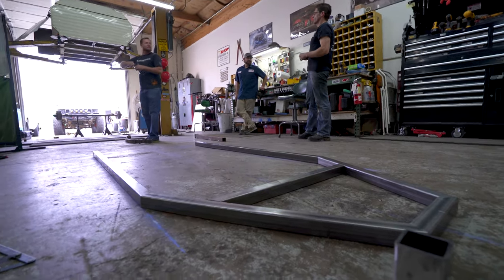I'll have a receiver in the back for my bikes. You want the coupler-to-axle distance to be the same as the wheelbase of the tow vehicle, and that hopefully will make it a lot easier to back up. With this short trailer it was just a pain to back up, and with the Ford it was almost impossible — just going back and forth. So now we'll have a much longer trailer tongue, so it'll be a lot easier to maneuver.